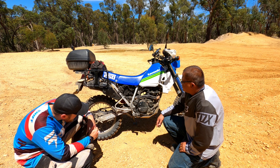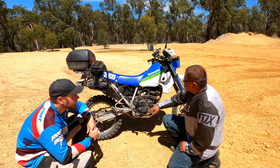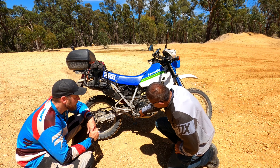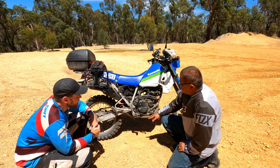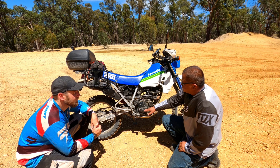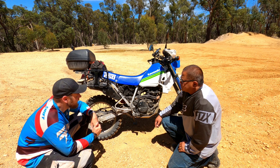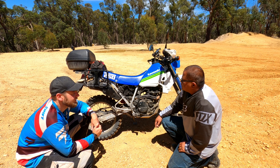Stock pegs and stock brake lever — I like to keep it original. One thing with this bike is to make sure the oil level is kept up, because it's well known that the valve train is quite weak when oil is low. Keep it topped up and it should be okay. As for finding other KLR250R owners in Victoria — I haven't met anyone personally, but I've seen a few on the marketplace, so you could always buy a parts bike if things got bad.